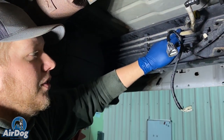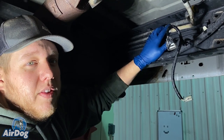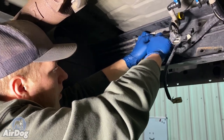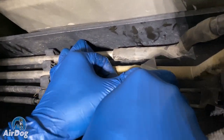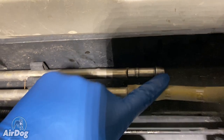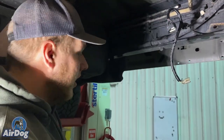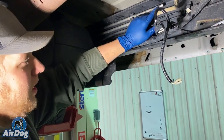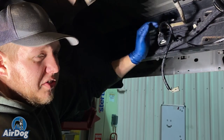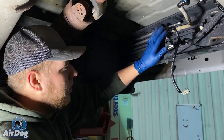We're going to need to trim this rubber hose off of this factory suction line. One thing to note: this is where a sharp razor blade is going to come into play, because any scoring you cause on this can create a suction leak — so you want to make sure you have a nice clean cut. We're going to utilize this barbed, tapered lead-in style fitting for the AirDog suction since it will completely seal on our hose and we'll be able to press the hose directly onto it. The reason we are doing this is because the AirDog pump is longer than the factory lift pump, which would cause a kink in that suction hose. This also varies between a regular cab and a crew cab — on this particular truck we are doing a crew cab installation.